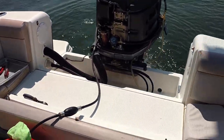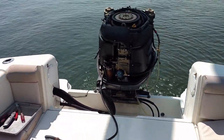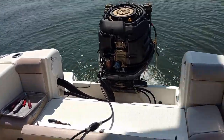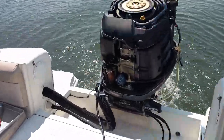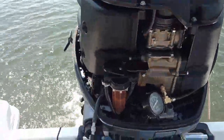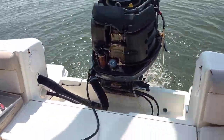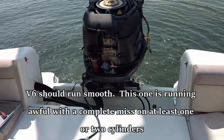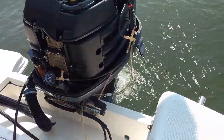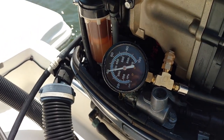Now it is to be expected — this motor is going to run like crap for a little while and it's still probably got water in the injectors. It's probably still got water in the bottom of the rails. Definitely got a miss on at least one cylinder. I don't know if you can hear it but definitely got at least one cylinder there that ain't hitting.